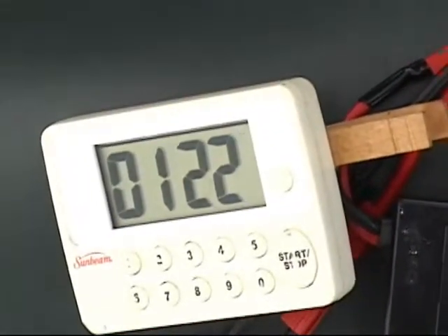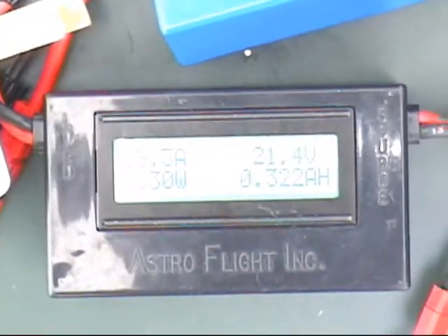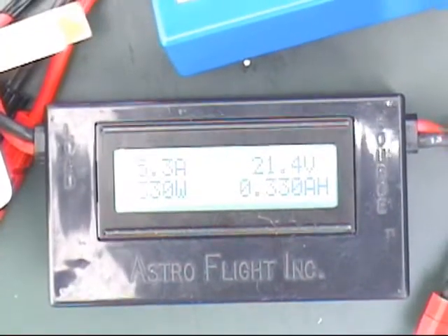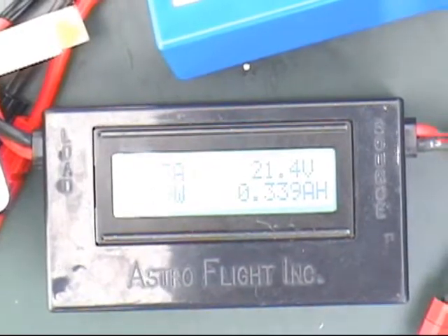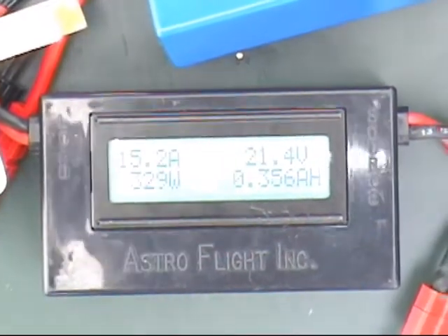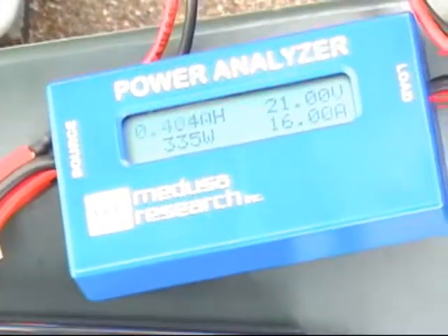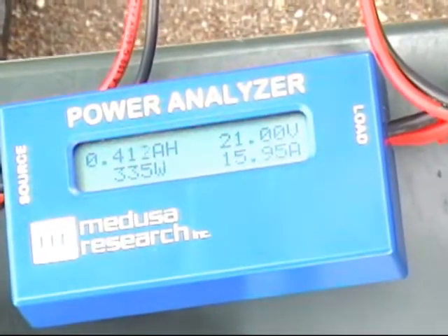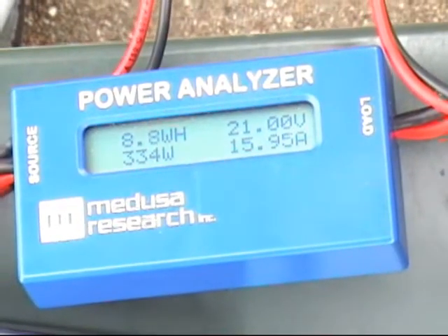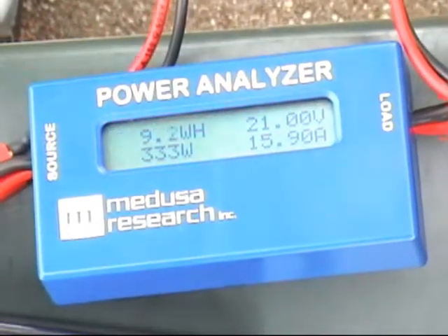At a minute and 22 seconds, we lengthened the charging cable from 12 feet to 13.5 feet, so it's pulling a total of 31 to 32 amps out of the lead-acid batteries, which they can take. I wouldn't want to go any harder than that.